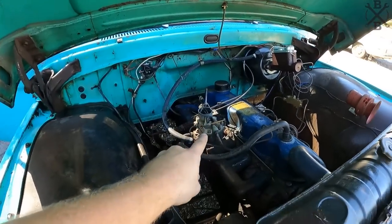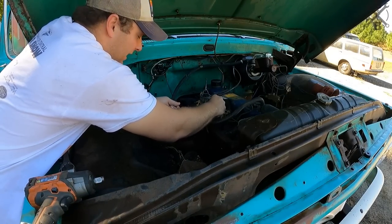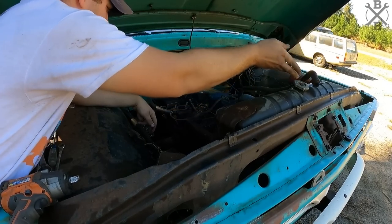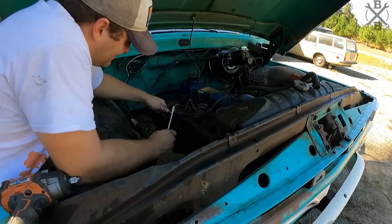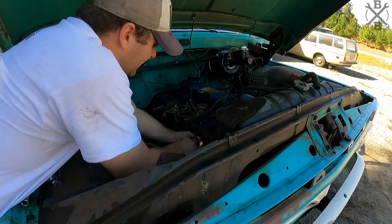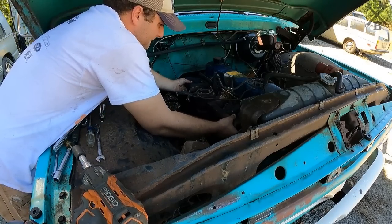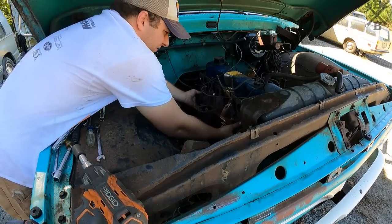First things first, let's get that carburetor, intake, and exhaust pulled off of this truck. We've had all of this off before, a couple times. So it should come out of here nice and easy. And off with the little single barrel. The intake and exhaust manifolds. Get our breather hose and booster hose off. First, then we can follow it with the exhaust.